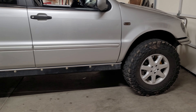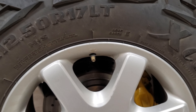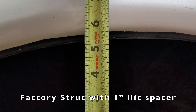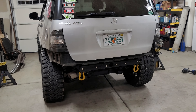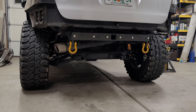Well, this is after the first quick drive after installing the new coilovers. So what do we got here for ride heights? On a cleat that's even, got about five and a half inches there. And on this side, on that same cleat, about five and a quarter. So a quarter inch difference — quarter inch higher on the new side. That's pretty much perfection because that coil is going to settle and it's going to drop down a little bit. Being just a quarter inch high on one side is fine — it's probably going to settle at least a quarter, maybe even half. And it's okay because we can adjust it back up.